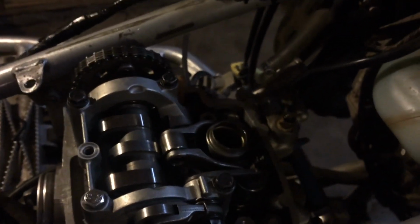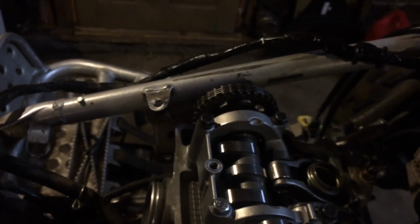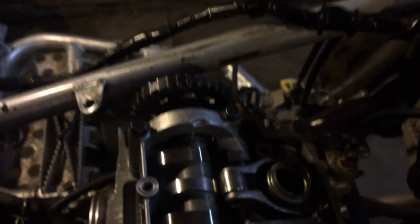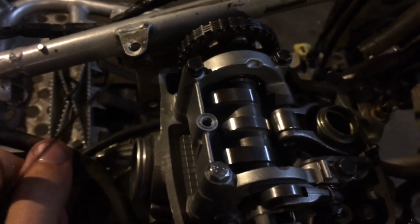I loosened the cam bolts, the cams up. Oh, that makes sense then, because I still have tension on the timing chain. I didn't see you do that. Alright, so we could get the feeler gauge in there just a little bit, which means I'd say it's either at 7 thousandths or just a little bit over. So we're going to try to find a shim that's a little bit taller to put under the intake lifter over here, and this one won't fit under at all.